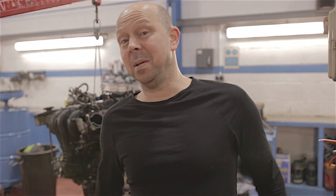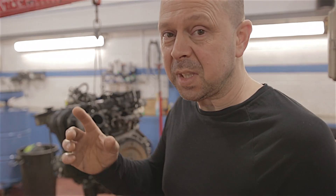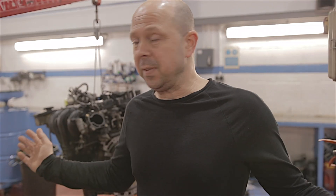There was smoke bellowing out from underneath the bonnet. Basically one of the conrods had snapped or broken the engine and punched a hole through both sides of the engine block. This particular car, a few weeks back, was driven through flood water and water got in the air cleaner. We believe water got into the engine and caused some damage, but when the water was cleaned up, it kind of started again and ran fine. So we believed the engine was perfectly good, and the guy who rented the car drove off again. A couple of weeks later he rang up and said his engine was clattering — obviously a conrod's gone from the side of the block.